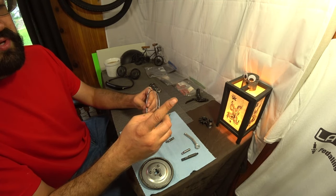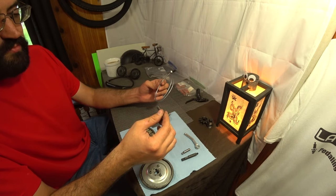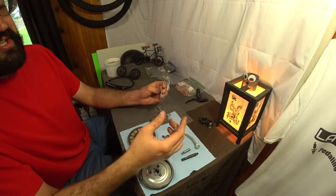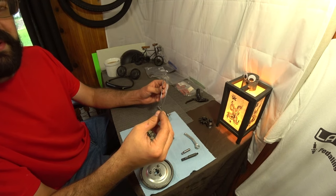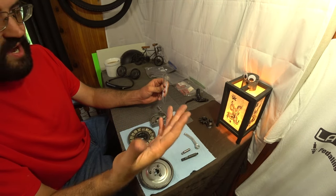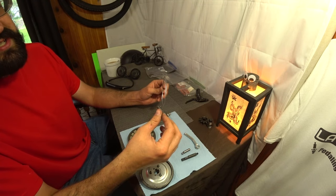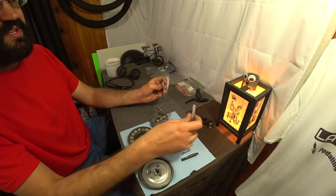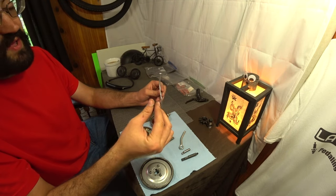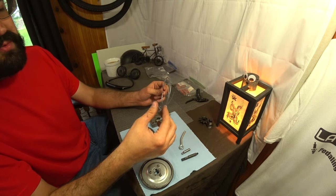The cables in these kits do not come with an end cap for a specific reason — you often need to remove and reinsert the cable when taking off a motor, doing repairs, or basic adjustments. However, I do recommend putting an end cap on this cable when you're riding, because your pants, shoelaces, shoes, and socks will begin to fray it slowly over time. Once this cable becomes frayed and you take it out of the clutch arm, it is very difficult to reinsert. So if you can prevent fraying with a cap, I highly recommend it. You can pop them off, sometimes reuse them, and even if you don't, they're pennies.